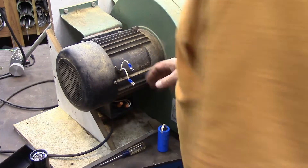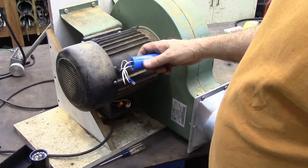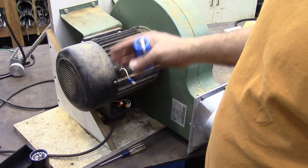So if I take those off, it's going to act like it did. This capacitor was just in there connected, and it didn't have these lugs. But when you try to start it, it's just going to hum for a few seconds and then it's going to blow the breaker. So I'm going to turn it on and let you hear that.